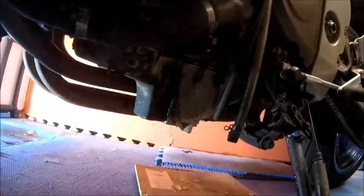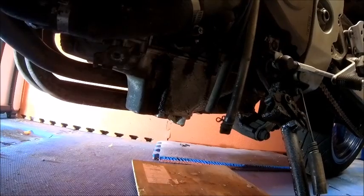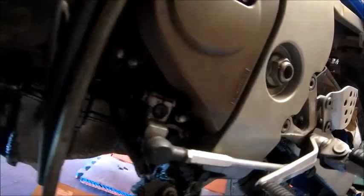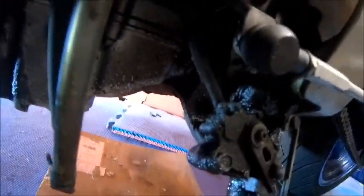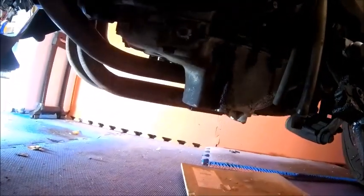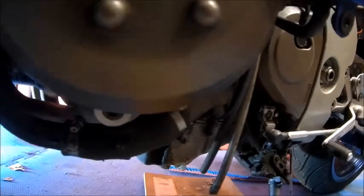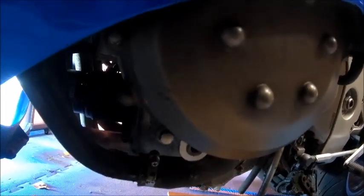When you've got it off, the front of your bike looks pretty much like that. There's a little bit of grime underneath there and a little bit of oil to be honest, so I need to find out where that's coming from. Most of that is chain lube but there's a little drip just there, so I need to investigate — I hope I haven't got a seal gone because that could be a bigger job.